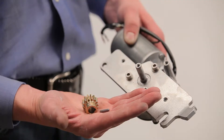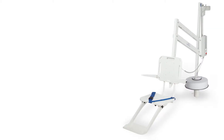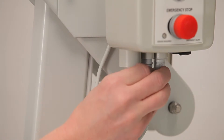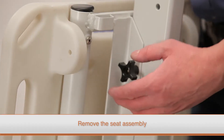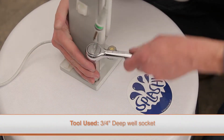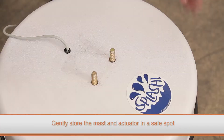If you need to replace the motor assembly, gears, motor cable, or the tension spring, you will need to disassemble the lift to gain access to these components. To access the motor and the gears, first remove the battery, then unplug all cables from the control box including the hand control. Next, remove the seat assembly by loosening the thumb nut on the bolt that attaches the seat assembly to the arm, remove the bolt, then remove the seat assembly. Now remove the mast using a deep well socket wrench to remove the nuts attaching the mast. Remove the mast assembly and be sure to place it so that the actuator arm does not get damaged. Finally, remove the lift cover.